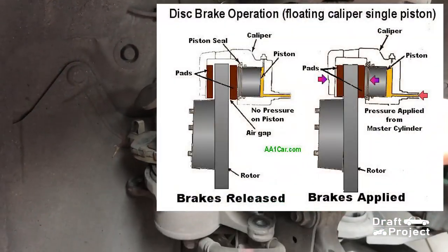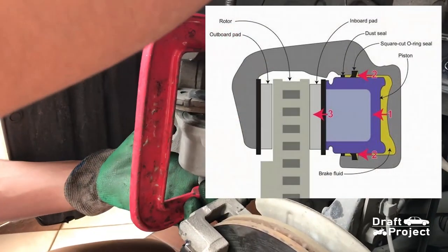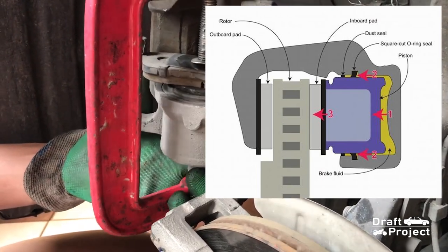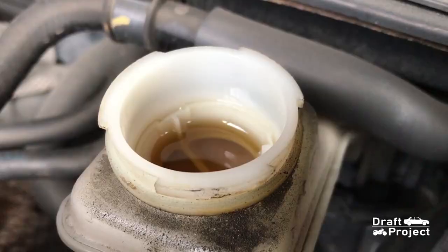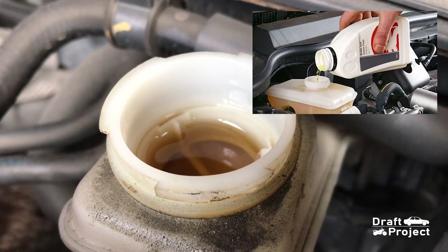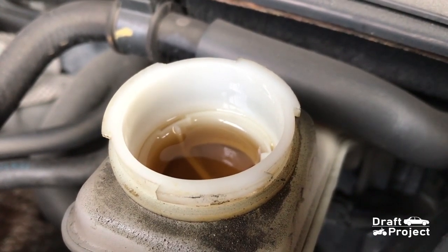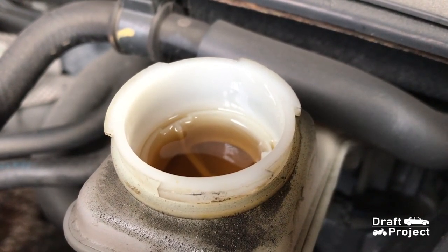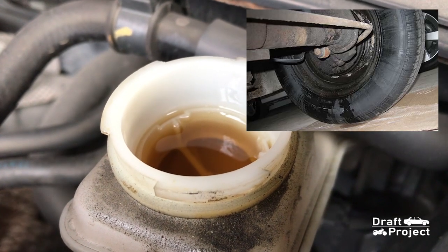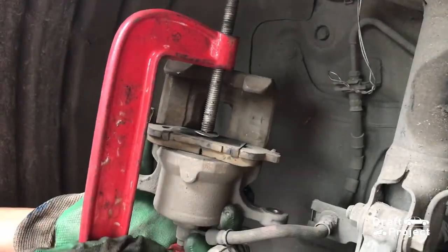Brake fluid normally decreases as you drive because the brake pads wear out. The brake piston will uncompress, pushing more fluid onto the caliper. The fluid level in the brake master reservoir will decrease. It is normal that we refill the reservoir as a safety measure, but if you did that, make sure to decrease it if you will do a brake job. If the brake fluid decreases excessively, that indicates a leak somewhere in the system, so always check your brake fluid level from time to time.